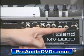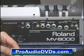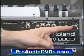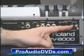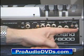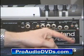On the rear panel, we'll find our inputs, both for microphones and line-ins in the form of balanced 1/4-inch jacks. We also have the ability to sample directly from a turntable without a mixer or preamp. You can just connect your turntable directly here, and you can also even run a ground line down here if you're getting any buzz or hum down the line.